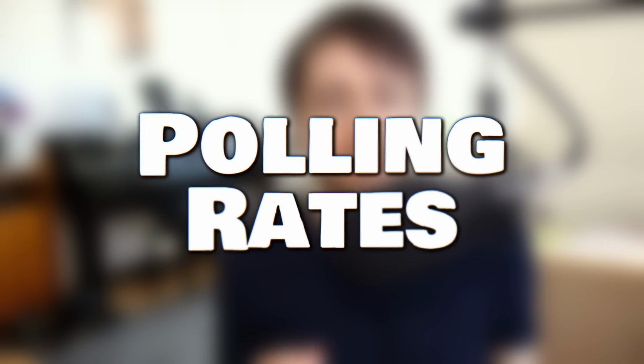What is the polling rate? I think in previous videos I've made some oversimplifications that left a few wrong impressions on people. The polling rate only tells you one thing: how often does the computer ask the controller for updates via the USB connection? If the polling rate is 125 Hz, the PC tries to obtain updates 125 times a second, which means once per 8 milliseconds. The controller is not forced to send information though, which is why the true amount of updates can vary. A high update rate will reduce the input lag, which will be covered more in the next section.